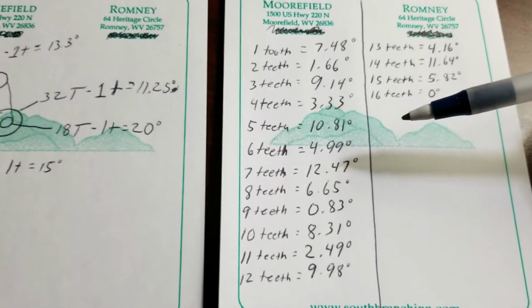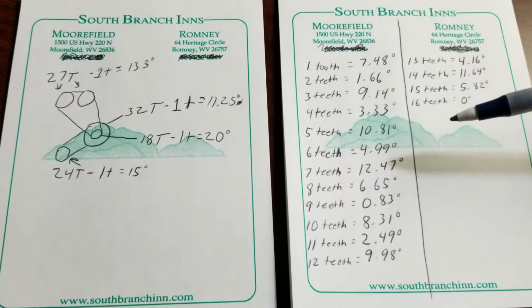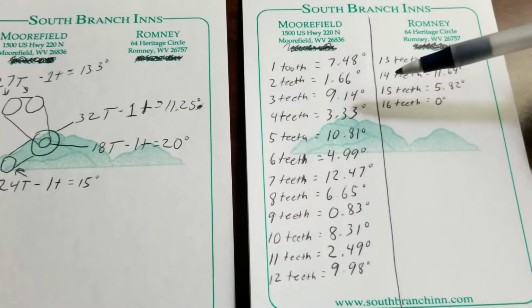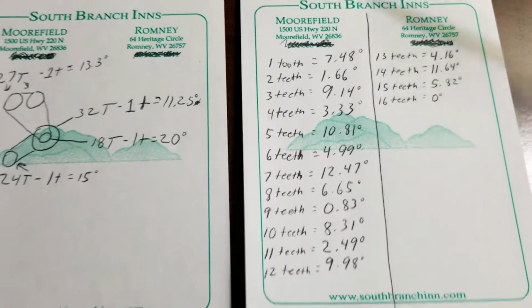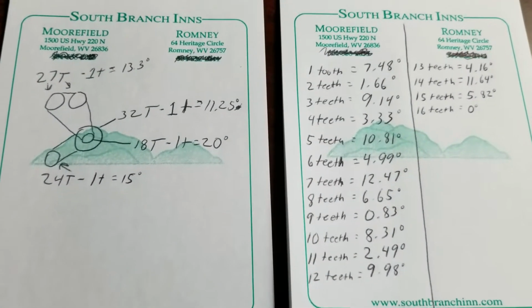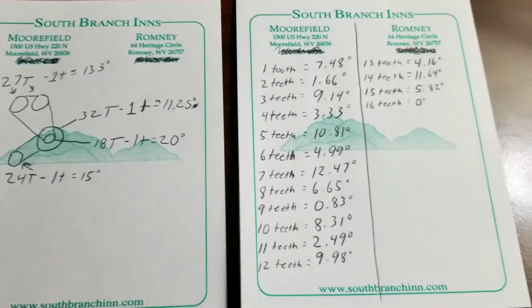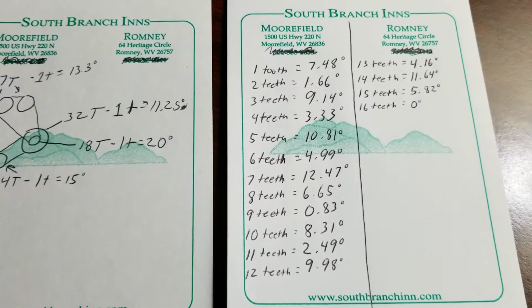And I can't think of any reason that the intermediate shaft actually needs to be in any specific location. It seems like all its purpose is to drive the oil pump. It does keep you in time, but it also seems to allow you to adjust the time. I can't find a flaw with this. I don't know if there is a reason that intermediate shaft actually needs to be in a specific position. I don't believe that there is. This to me seems like it should work for me, and it seems like it should work for most people that need a little bit of adjustment.